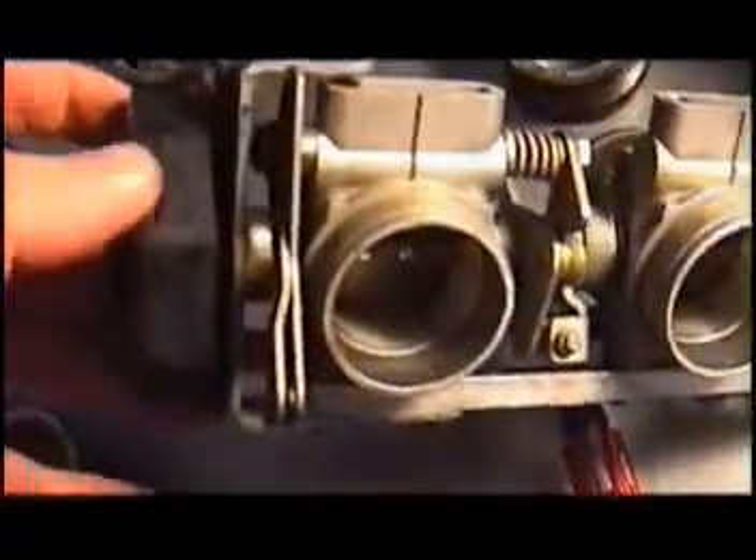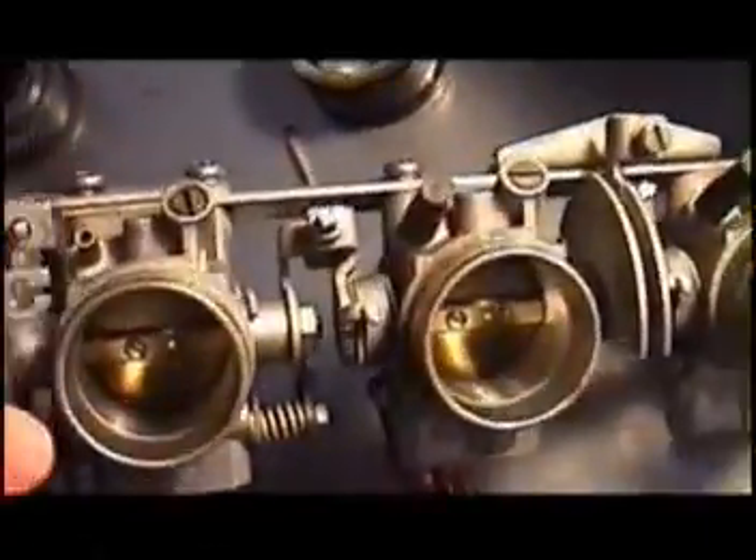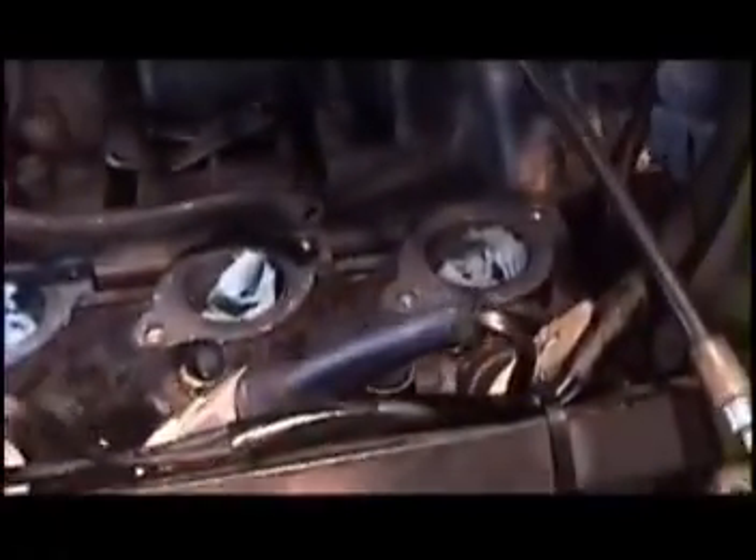You don't want to disassemble these parts any further. They're all cleaned up. On the left is the fuel shutoff — or idle fuel shutoff below 2,000 RPMs. You don't want to move or disturb that; keep the screw tight. This area is super filthy, which is a good reason to pre-wash the bike. I saran-wrapped the throttle bodies and did the same with the plenum chamber. On the top there's a slot. Here's the water pump plug — notice there's a little dielectric grease in the center.